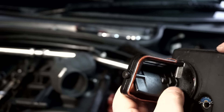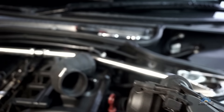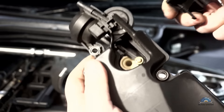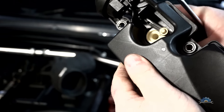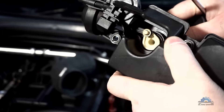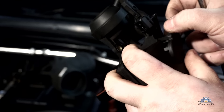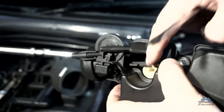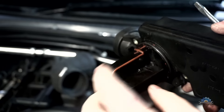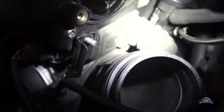Pay attention to the flap which causes many problems — the rod inside and the plastic. On this side you can actually examine it by removing the cap. If you remove that cap you'll see a plastic mechanism. This one was replaced — the whole thing was replaced — but usually this part fails and moves, but the flap stays open. If you're having a rattle or something, you can buy a kit for those two parts and don't have to change the whole unit. It's good to check and clean it.